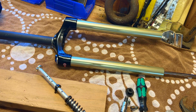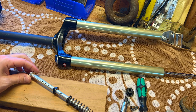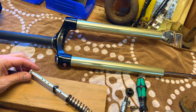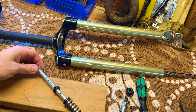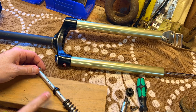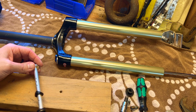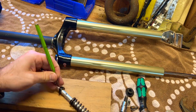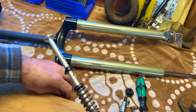We're going to knock this pin out. I found a punch that fits through the hole to knock the roll pin out. I've seen other people use a similar method where you support the assembly closely on either side with a soft material. I just put a quarter inch hole in this block of wood here. Knocked it through — all the way through our hole there.